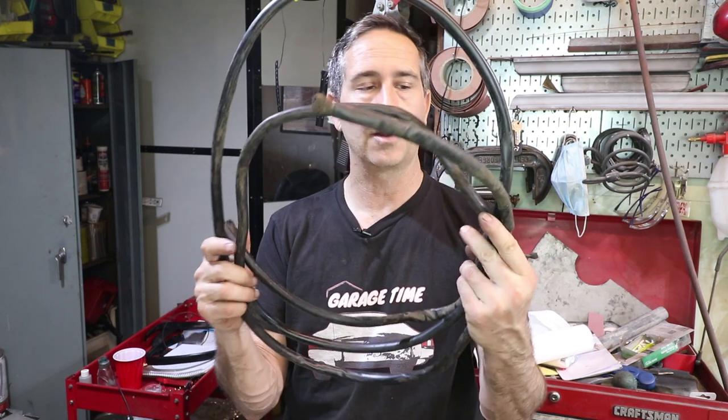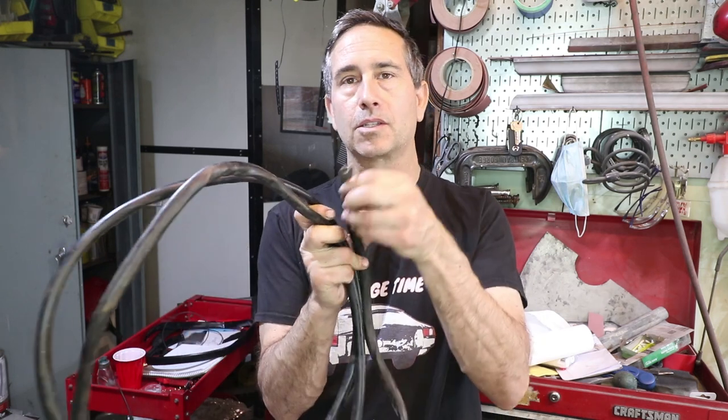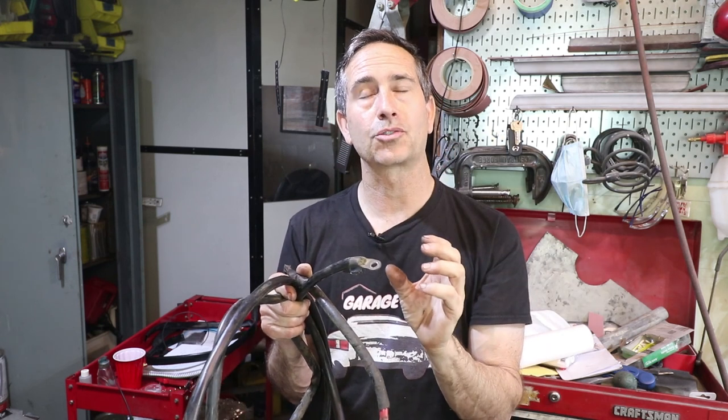I've been placing orders and checking the other harnesses. The other really important piece is this heavy gauge cable that goes from the battery to the starter — you can see the lug right here on the starter. I'm just going to replace this whole thing. For six volts it's basically twice the current you'd have for 12 volts, so I think the factory was 35 millimeters squared — that's a little bigger than 2 gauge. I'm going to go with either 1 gauge or 0 gauge to get the most current to the starter for the measly 6 volts. The trick to starting really well is getting all the power from the battery into the starter. The other trick I did on the 911 is called a hard start relay — it eliminates the current going through the ignition switch and gets full power to the solenoid. This hard start relay is the only non-original thing I will put on the harness. Thanks for watching, we'll see you next week.